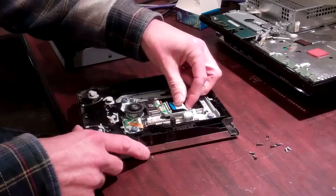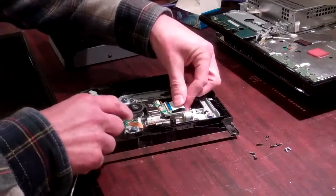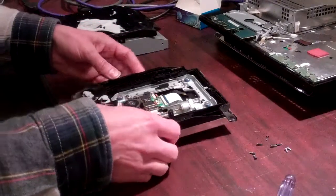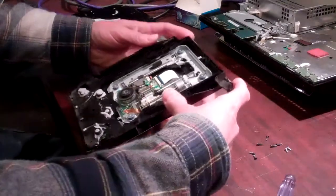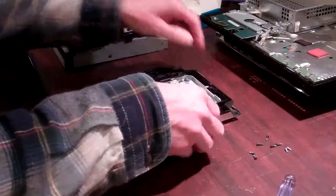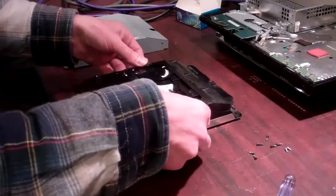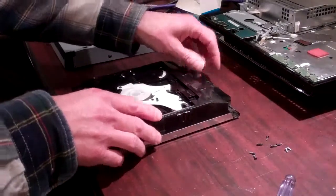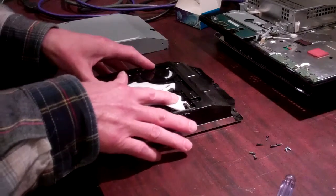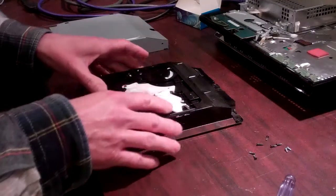Once that's back into place, lift the lever on your laser. Make sure your cable goes all the way in, and when you lock it down, the black stripe should be flush with the arm. Now make sure your bottom cover is in place. Then take your top piece, drop it directly down again. Make sure that everything's flush — you want to move this piece here, and when you move that, you should see your arm below is cocked so that it's actually moving back and forth.